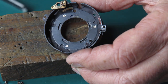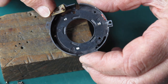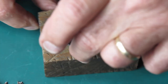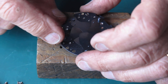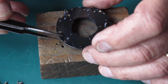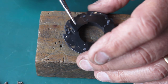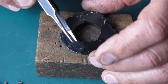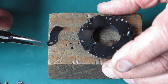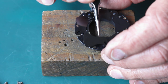If there was any obvious contamination of oil in here I would take that plate off to make sure I clean behind it, but there is none so there's no point doing that. The case will need to be cleaned carefully. Let's have a look at the mechanism plate — we've got six blades. One's a cover blade. Let's lift these off. That was our sixth blade; it's a cover blade, it's quite narrow. One's a cover blade.